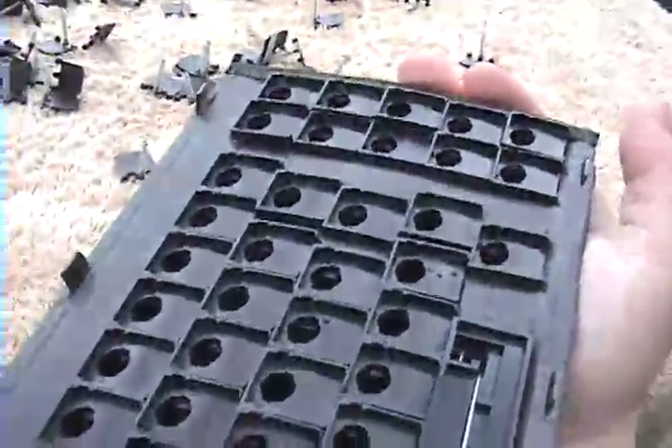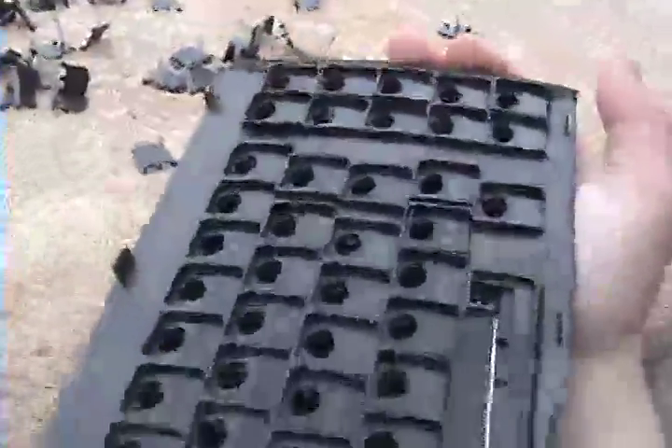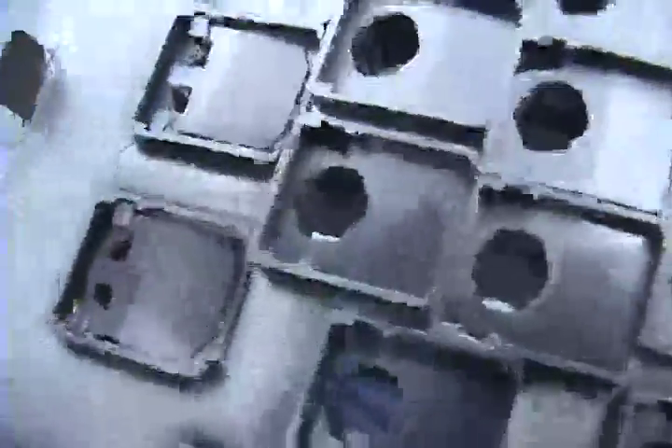Once you've done this, make sure you line up all tabs. I'm showing you the different angles at which you can position — you can call them cylinders. Those tabs right there must be lined up properly. Got them all inserted, and now we're putting the plungers into each and every one of them — you've got 83 of these, maybe 84 or so. Slide the backer plate into the notch. This is what your keyboard should look like before you place the circuit board back on. I'm going to be tapping the punched plate side so that it forces it into the notches. As you can see on the right-hand side, the tab is bent — that is the one used to hold the assembly together. So bend that back to where it was originally, and you should be done.